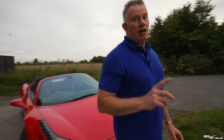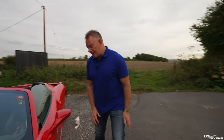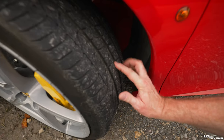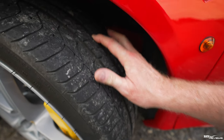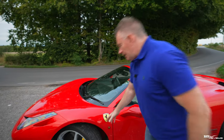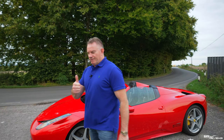We're just going to see if the tyre tread marker is exposed by turning the steering wheel to one side, and as you can see it is. So you can check this tyre as well, and it's very easy to run down and see where the tread marker is. The tread marker's there. Unfortunately, it's a bit in the wheel arch, but again, we've got loads of tread left on these tyres, so no issues whatsoever. So 1.6 millimetres across at least 75% of the width of the tyre across the whole circumference.